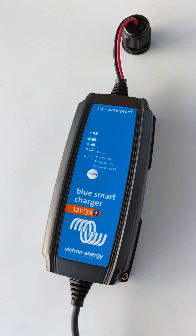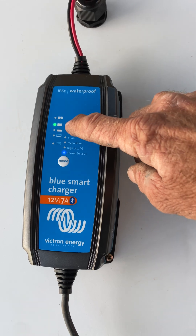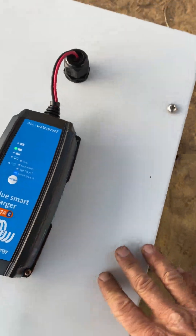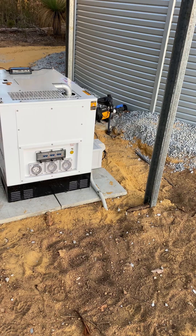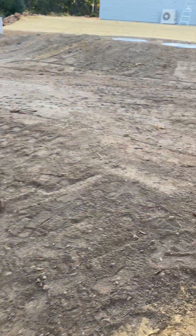I've put a battery charger on here just to maintain the battery. At the moment it's putting a bit of charge in, and it can also go into storage mode, which is great — because you don't necessarily want any regular battery charger connected to your battery or you'll destroy it. So that's a special battery charger that can do storage or maintenance charging.